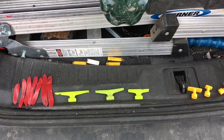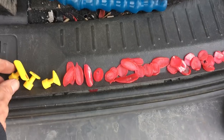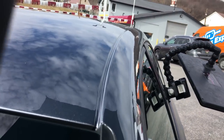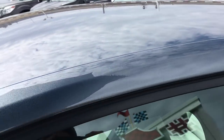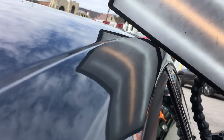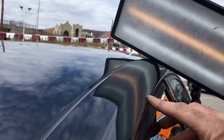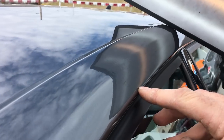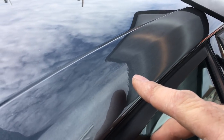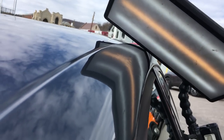We had a few pulls with those. I did use this several more times — several more pulls with that, which was helping out a lot to try to bring up some of what was left in it. I'm going to get some lighter light on this. The dent was in this area here — up here in this body line. It's by no means perfect. See all the texture in here — what we call aggressive orange peel. It looks significantly better than it did.